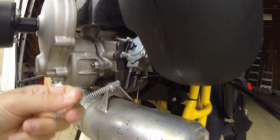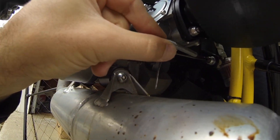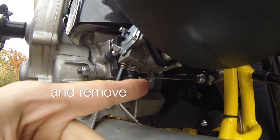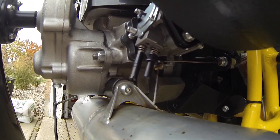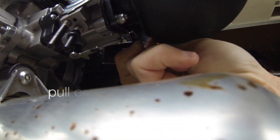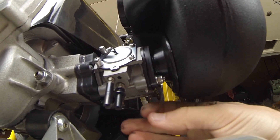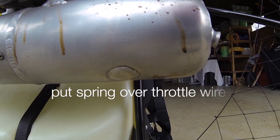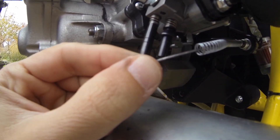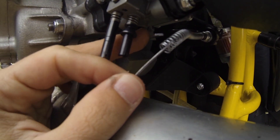This guy is going to go under — I don't know if you can see this big long throttle cable — it's going to sit right there. So I'm going to install that now and show you what it looks like. First thing I had to do was loosen this little locking nut using a flathead screwdriver. You just want to pull this guy out. Now I've got to feed this end through the end of that lever — what's in my thumb needs to go through what my middle finger is moving.